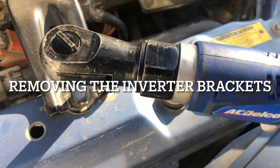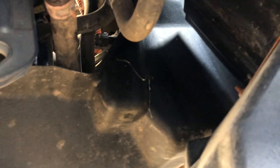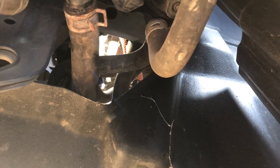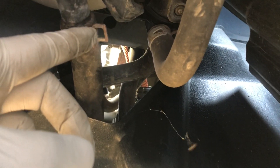Let's start removing the 12mm bolt that holds the inverter — this one and this one. I'll jack up the car on the driver's side. Basically one of the hoses on the bottom of the heater valve is connected to the coolant heater storage. It's easier to remove the hose from up here than down at the heater valve.